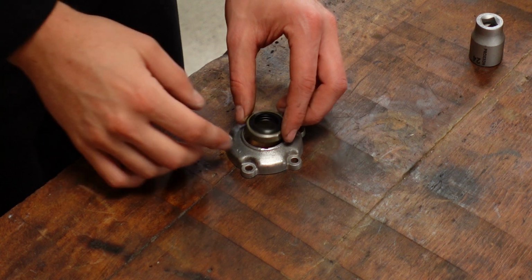Now if you're wondering which side of the wheel goes up and down, the side of the brake has a little lip on the bottom, so that one is the one that goes down, and then you push from the closed side all the way through, and then basically once this cools down it's all nice in place. That's a very cool way to install new wheel bearings.